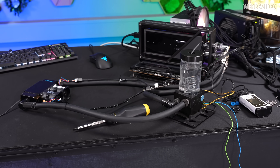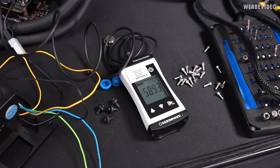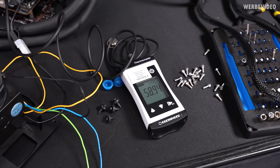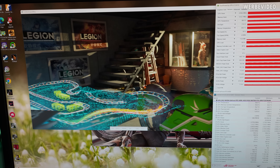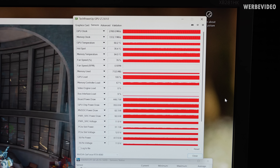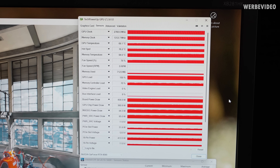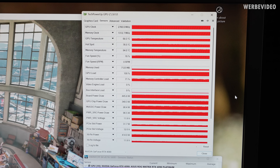It has been running for over 15 minutes. Maybe not great, but it's running. The water temperature is still slowly increasing, but really slowly. It will take time to reach maybe 60 degrees Celsius. The air temperature almost maxed out at 39 degrees Celsius. You can see that 3DMark is still running — hardware info shows it's been over 15 minutes. The temperatures are maybe not as cold as you'd expect from water cooling, but with 68 degrees Celsius on the GPU it still works. The memory temperature though is a bit high at 94 degrees Celsius. After 30 minutes, the temperature evens out at 59.5 degrees Celsius and stops increasing.